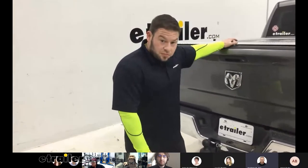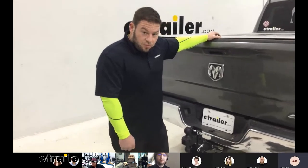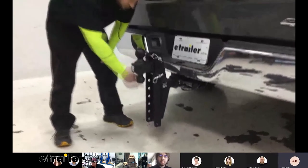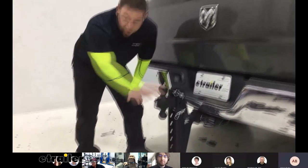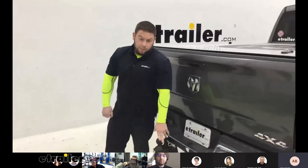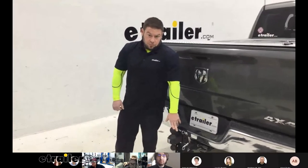What drop and rise did you say this product was? There's a lot of different ones. This one in particular is a four-inch rise and a six-inch drop — it's an offset, with four on top and six on bottom. But there are a bunch of different versions. The heavy duty goes up to a 16-inch drop, and 12-inch is the maximum on the extreme duty.